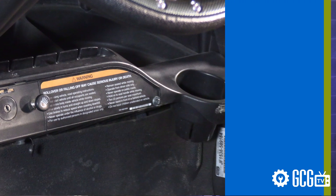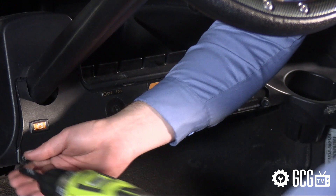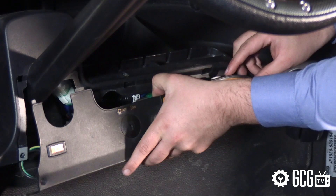You'll want to start by checking that the parking brake is on and switch the cart from run to tow — anytime you perform any kind of electrical work on your car. Next, you'll want to inspect your dash panel below and to the right of your steering column. Here you'll find your low battery indicator light, key switch, and probably a light kit switch if you have one installed. This dash panel should be held to the cart with three bolts — on our model these are torx bits, however you may need a screwdriver or allen key bit depending on how yours is affixed.